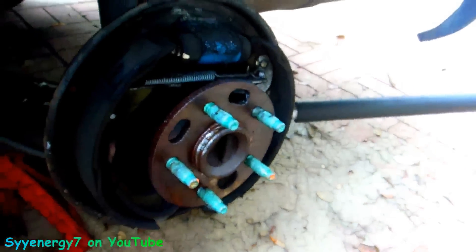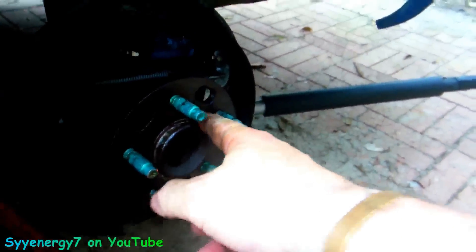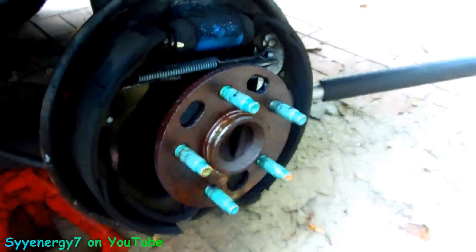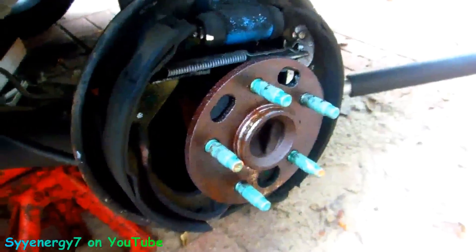There's a little bit of meat left on those hubs, not a lot. What we're gonna do is clean this drum up real good with starting fluid, wire brush all this rust, and paint it with some rust-killing primer after it's all cleaned up. Paint it on the outside and on the inside a little bit where it mates, then put grease all around in here. So this will never do that again because it'll have the rust-killing primer and it'll have marine-grade grease.